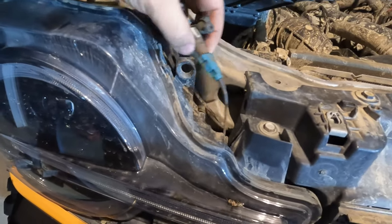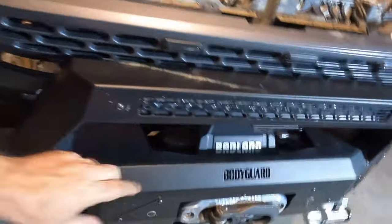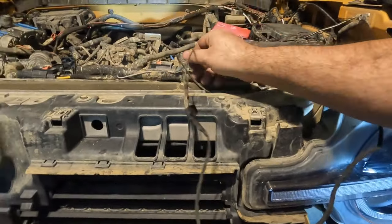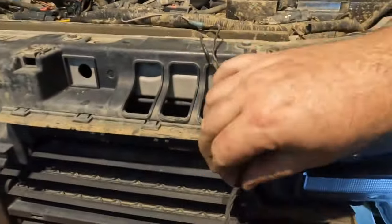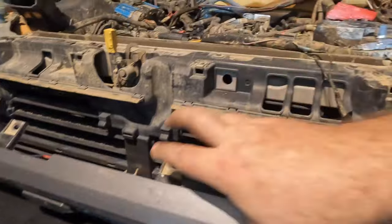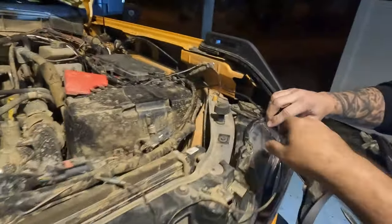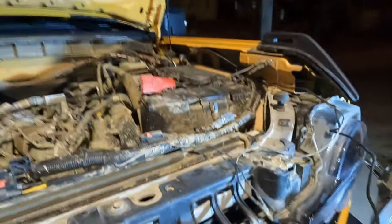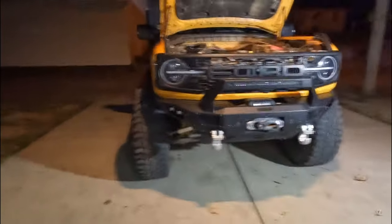Matt does not have the washer, and the camera has been relocated up on the bull bar so that's not connected. There is some wiring connected for the Oracle Bronco lights, which we'll be disconnecting, and then the raptor lights, which we'll just be switching over to the newer raptor lights. The Oracle lights have one ground we can disconnect, and then we'll snip the power — and like that we're done.